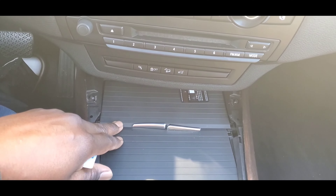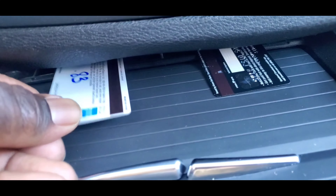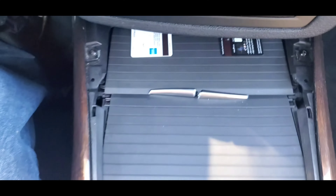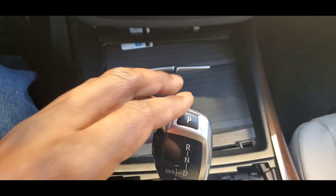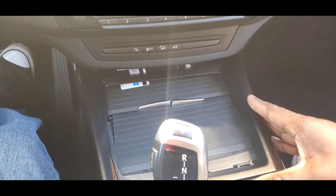This is to show you how to put in the trim after repairing the rollers for the cup holder. What you're gonna do is — you can see that lip right here — you want to create a ramp right above that lip, just like that, and then one on this side. Kind of have them spread apart like that, and then what you do is take your trim, kind of move the gear shifter back, put it in like this, get it angled up the right way, and then once you get it about right here you're going to push on it.